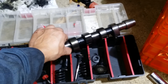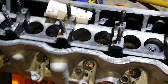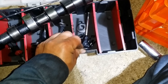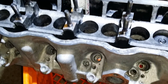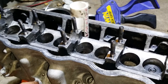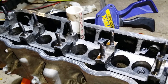For those of you that want to know what kind of damage you can do, this is just one of them — you damage your cam, you damage your whole cylinder head pretty much. Once you get damage here you can't fix it. I brought it to a few shops and they can't fix it. Valves completely clogged, piston rings completely seized up, every single one. Once the ring seizes up you're also going to damage your cylinder block toward the top, and pretty much you will need a whole new motor. Thanks for watching.